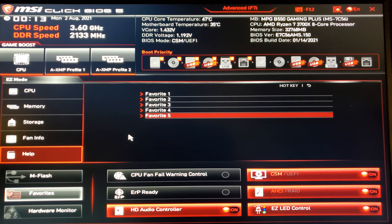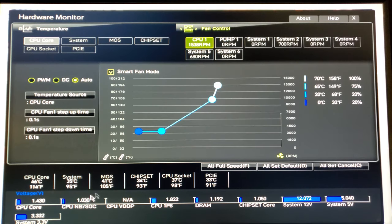Obviously, you just have to have a motherboard that will support all those CPUs. This particular one, as I said, is supporting only third generation and beyond in terms of Ryzen. So first and second gen may not work on this board. There have been reports of them actually working on some boards, but it's basically hit or miss, or just plain old luck.